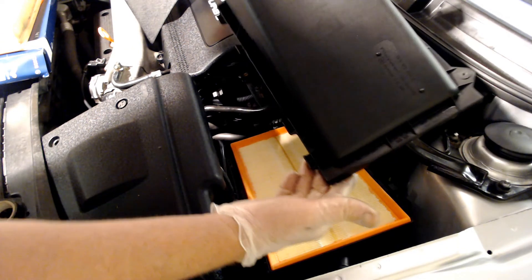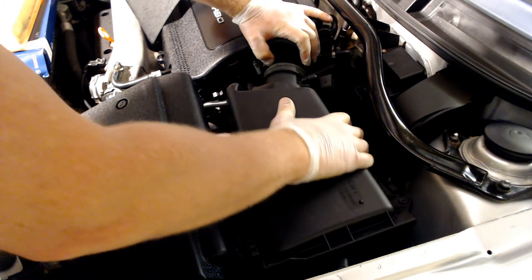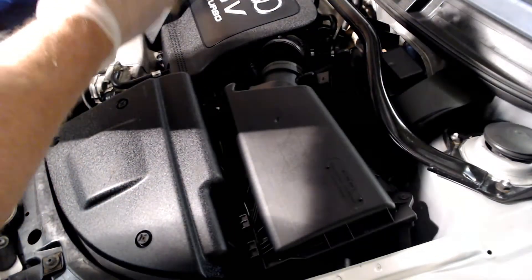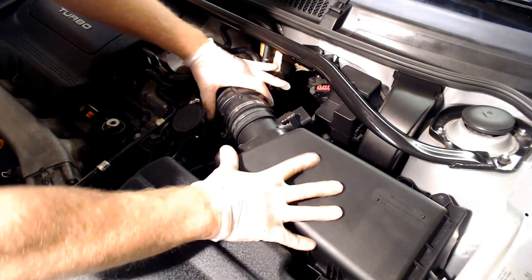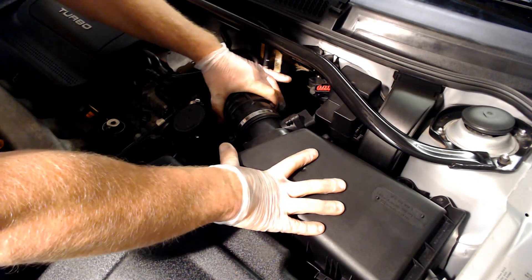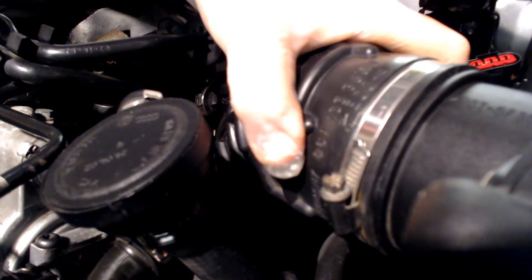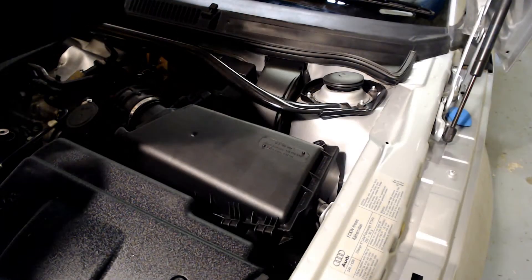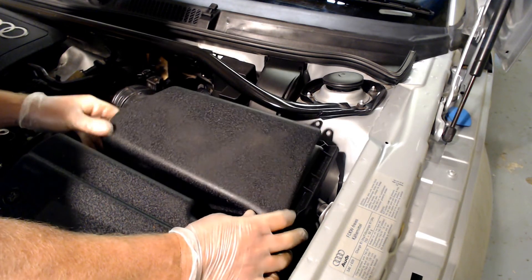Next, take the top of your air filter housing and ensure that you engage the black plastic hinges. You need to make a good seal the whole way round. Remember to dispose of your old filter safely for environmental reasons - put it back in the new box and close that up. Take the air hose, place it back over the filter, and tighten the jubilee clip up nice and tight - make sure there's no movement in that pipe. Reattach the electrical connection for the back of the air box and make sure that clicks into place. The last step is to replace the air box cover or shroud, which clips onto the front edge of the air box with the two clips. Make sure these engage, then screw the two screws back in at the rear of the air box.